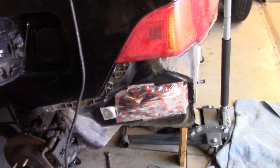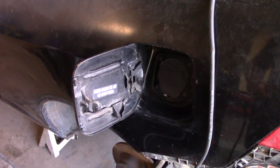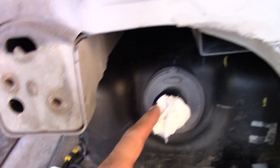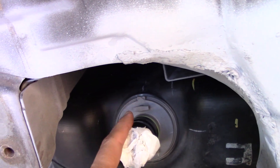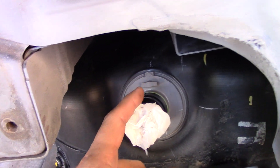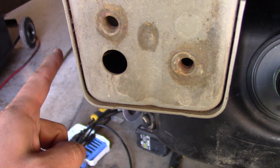I got parts on Amazon. I'm gonna list all the parts you need if you ever want to do this. You need a Gates hose — it's a 90-degree hose — and the 90-degree hose is gonna come out here. Then I got a 304 stainless tube that's one and a half inches. The RSX filler neck is one inch, so this is one and a half. The 90-degree comes here and goes this way.